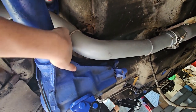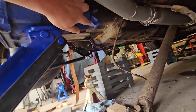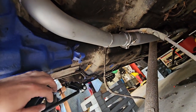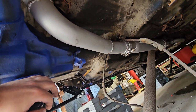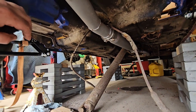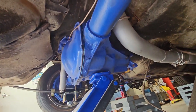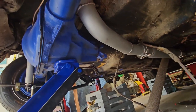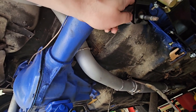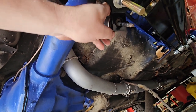It's really tight right there but it's not touching. The other issue is the driveshaft - it's just too long. I can't quite get it on there and I think it's gonna hit the v-band clamp. So it's not worth making a driveshaft that'll fit between here and the original Pinto transmission, meaning we're not going to be able to do a test run. We've got to come up with something for the shocks. I think you can buy an extension or make an extension - we'll probably do that.